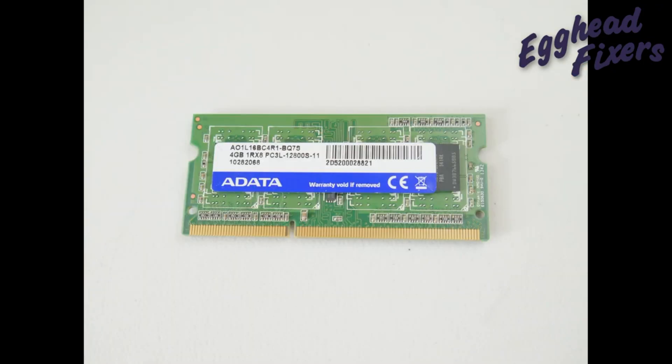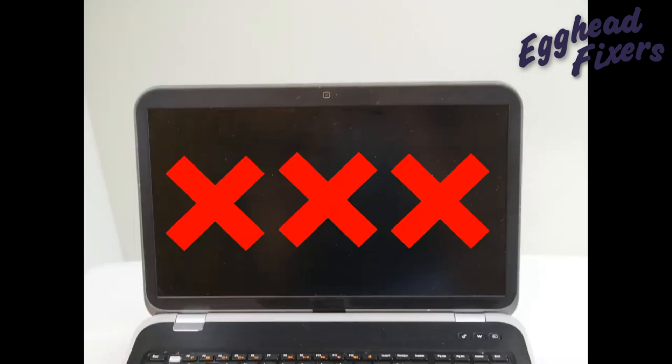If you have a bad stick of RAM and want to know how to order a new one: this is the manufacturer label, and you're going to look for the part number or data transfer rate. That's what you'll enter into Amazon or eBay to find a correct replacement stick of RAM. Down below we have common replacement models listed, so you can compare with what you have. We have links to Amazon in the description. If you open up your computer and find you only have one stick, you'll have to order a stick and try it with a working one.